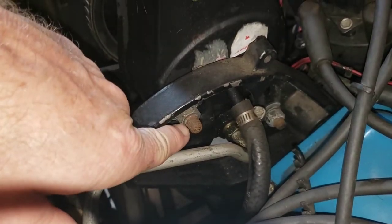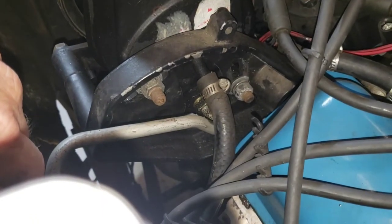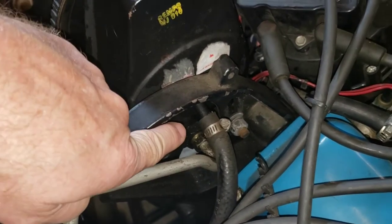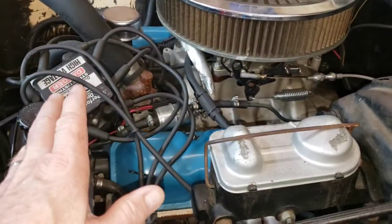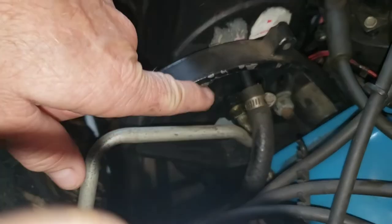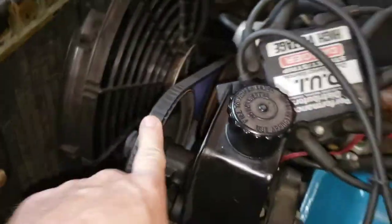So let's get busy doing that. We've got two bolts here — a 9/16ths here and one down there. That's your two pivot bolts and this whole bracketry affair; none of that stuff moves. It's been years since I've loosened this up — I've turned every bolt on this Jeep, but I haven't dug into this belt system for four, five, six years. So let's loosen these two up and get these belts off the engine.